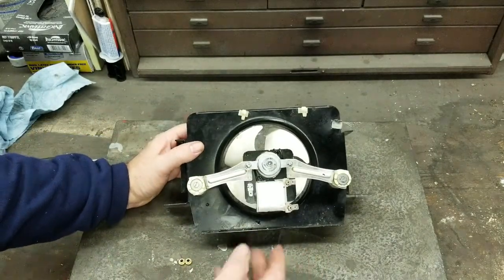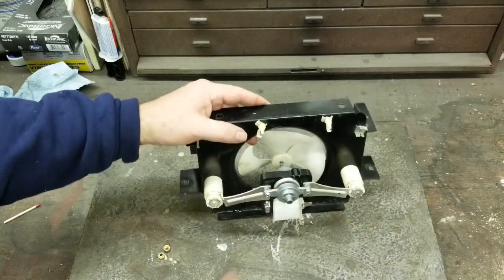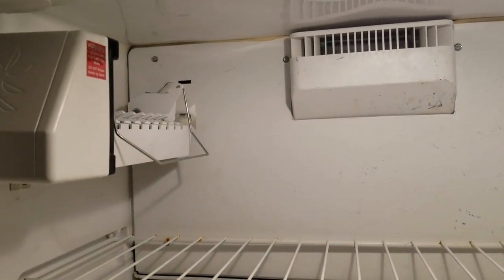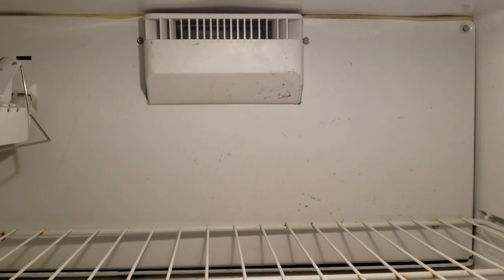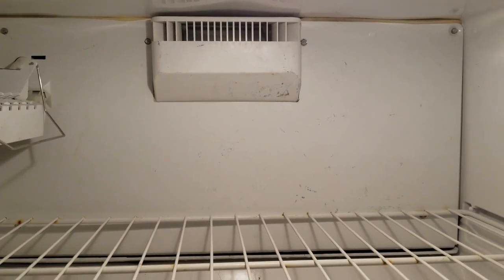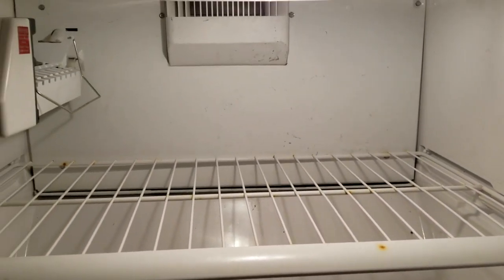As you can see, we've got it back together. The fan is back on it, no clearance problems, and it turns free. All we've got to do now is go back up and get that thing back into the refrigerator. We've got it all done — the ice maker is back in and the handle is down. We'll let it start cycling and make sure everything's good. The motor is much quieter than the old one, and in fact my wife commented immediately on how much quieter the freezer was.